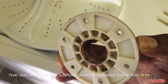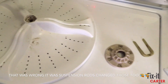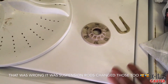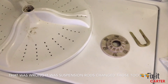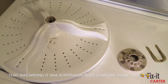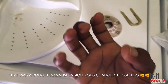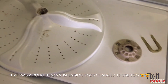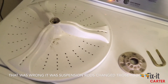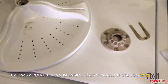You want to replace both the washer wheel and the drive hub. The teeth on the hub didn't look too good either, and I didn't want to have to go back in and change it after replacing the washer wheel, so I replaced both as good practice. These are inexpensive enough. Go with an OEM-spec quality one because there's a lot of torque and it's only holding on to plastic — a little play will strip those teeth. The replacement washer wheel I used actually had metal splines inside so it grabs onto the metal and won't wear down as easily as plastic does.